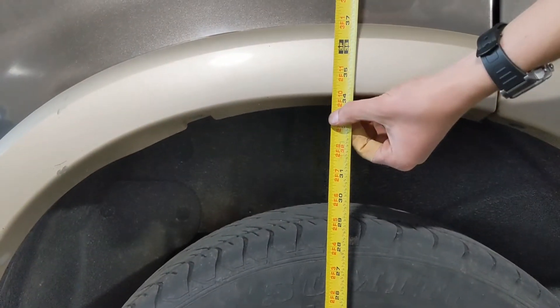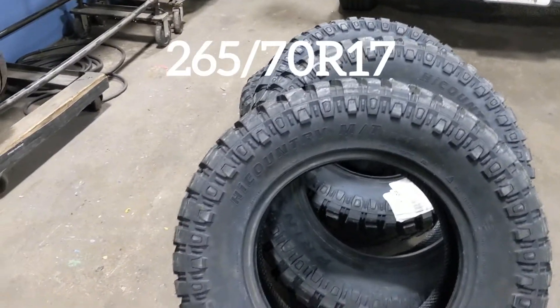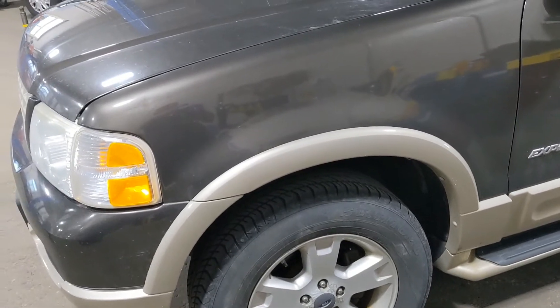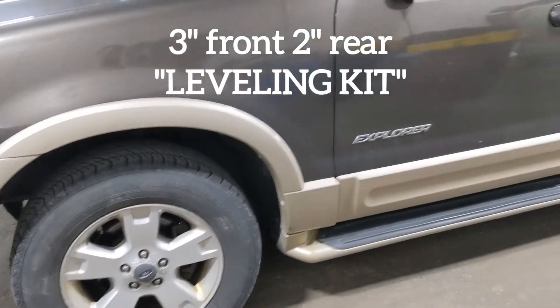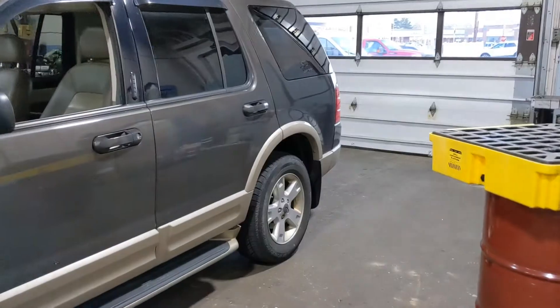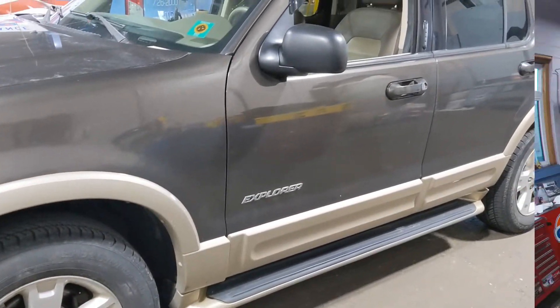About 34 — we'll call it. So our goal: we've got 32-inch High Country MT mud tires. For the lift, we're putting a 3-inch front and 2-inch rear spacers that go on the struts. We'll also remove the running boards, remove the air dam, and remove the rear mud flaps. Let's see how it works out.